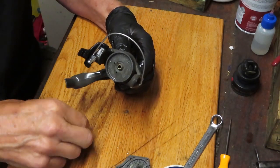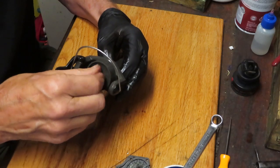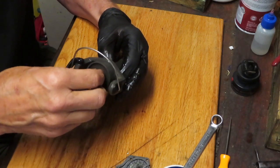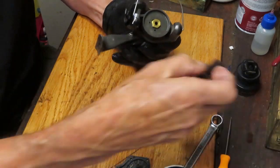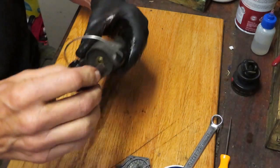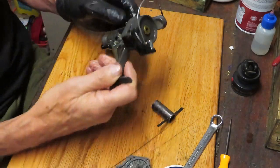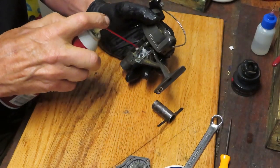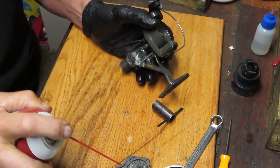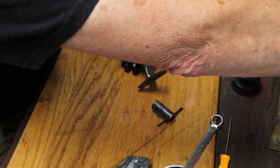Let's grab our nut and put that back on. And we'll do the base. Again, 12 millimeter, I use the wrench. You can use a deep socket ratchet. And before you go much further, spin it. And of course, that's spinning a whole lot better than it was, right? All right, I'm going to use the penetrating oil to clean up the old greases in here and on the cases. And then we should be able to reinstall.